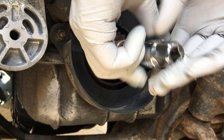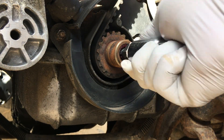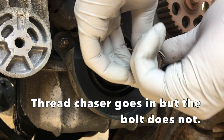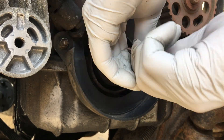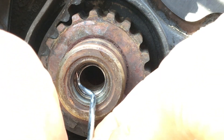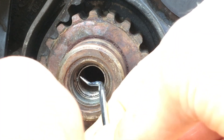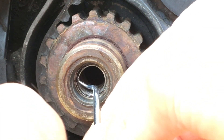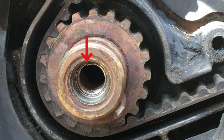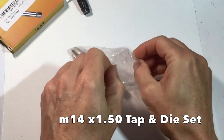I could get the chaser in by hand as well, but I couldn't get the bolt to go in. After this, I inspected it more closely and noticed a hanging thread, so I decided to pry it off to try to get a better, cleaner surface area of the threads. I think I just broke it off. You can see the damage is at about 12 o'clock, so my situation calls for more than just a chaser — I'm going to use a tap.